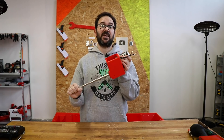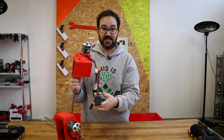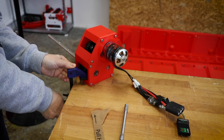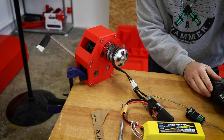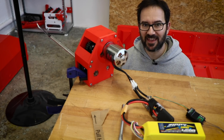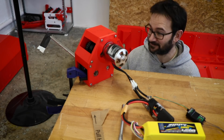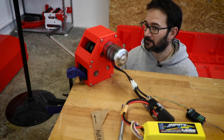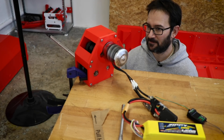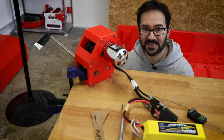We have one finished here, and I've already done the other one just to check if everything fits. This one has an ESC and a receiver connected, so let's test if it works. It seems that it can go slow, which is a must — this is a huge tank, a hundred-and-something kilos going berserk is not ideal. I need some finesse in the control. Let's see if we can go faster. That's scarily fast. We can go forward and backward, so it seems this works! Let's see if it fits back in the tank.